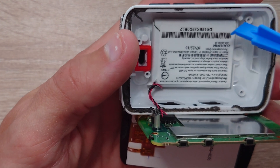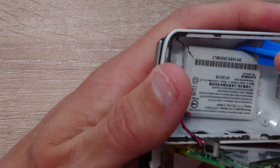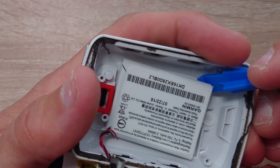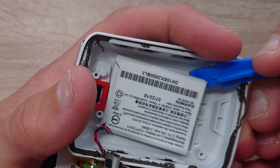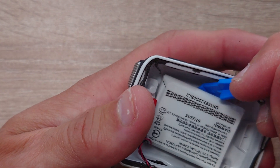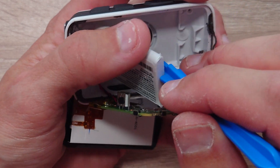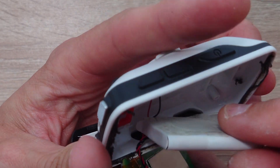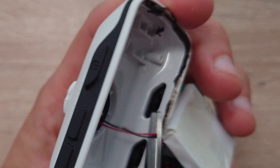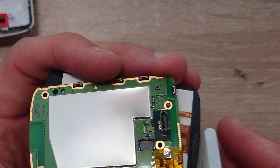Using your plastic removal tool, get it just under the edge of the battery to help start removing it from the base. It does have a layer of double-sided adhesive which keeps it really nicely firm and secure. Now that the battery is loose, you'll notice that two wires directly from the battery feed onto the speaker down below — just snip them off with your scissors and we'll remove those wires later. Next, release the battery connector from the motherboard using a flat-bladed screwdriver.